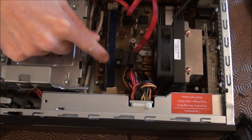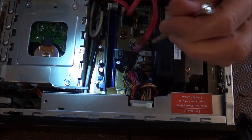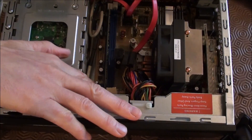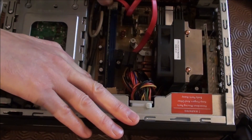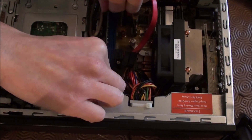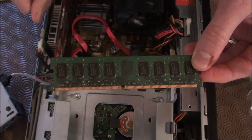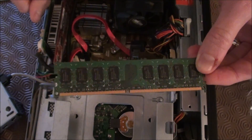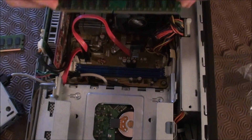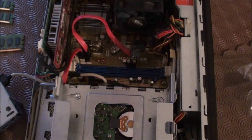So this strip of circuit board here is the memory, and it's held in with two clips — a little white clip at each side. What you have to do is carefully get your finger, mind the cables, and push each clip at the same time. You'll get a nice little reassuring click and you can just prise the memory out. So this is the old strip of memory — two gigabytes at about 600 megahertz, which is the speed of the memory. I bought this new memory off eBay, actually — only a fiver. These are two strips, two gigabytes each, at 800 megahertz.